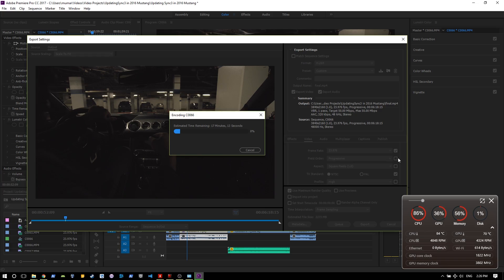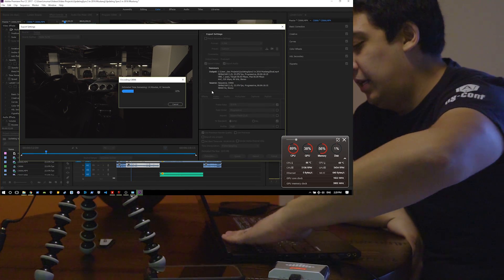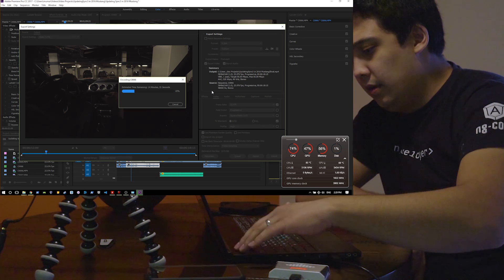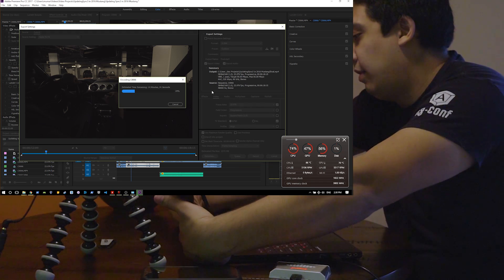I'll select cooler booster mode — this kicks both GPU and CPU fans to maximum. The CPU is already at 5000 RPM. The CPU temperature stays around 85-86°C with fans at maximum. The GPU is around 70°C but GPU usage isn't as high as the CPU. This computer has two GPU fans, which is why the GPU runs cooler. The keyboard area is a little warm but not hot. Most of the heat goes out the bottom and back — if you put your hand to the back of the computer you can definitely feel the heat.